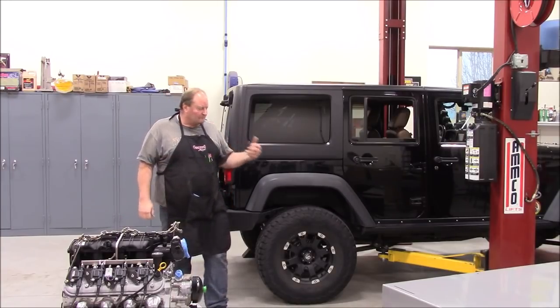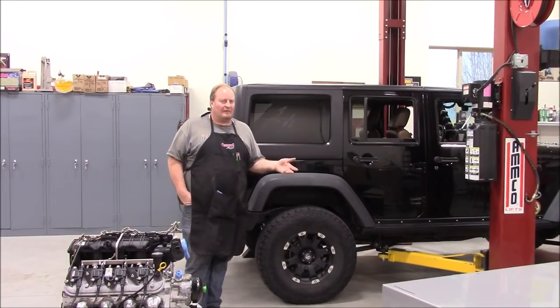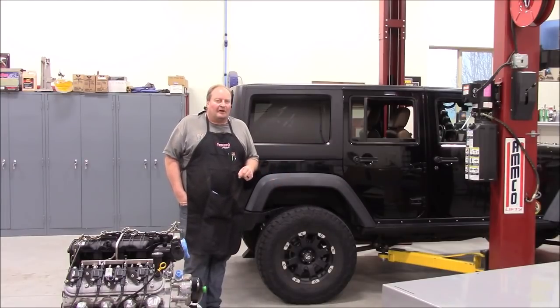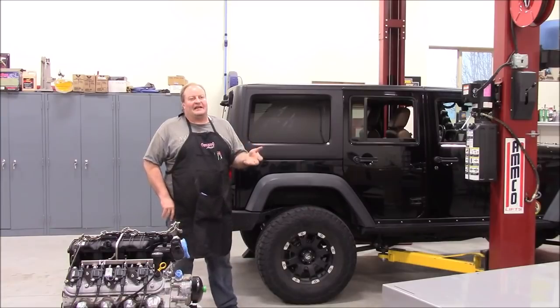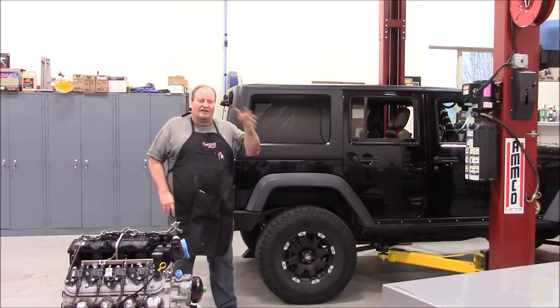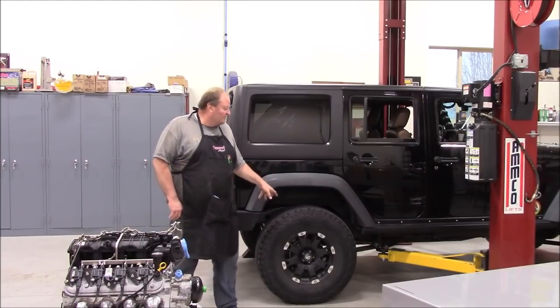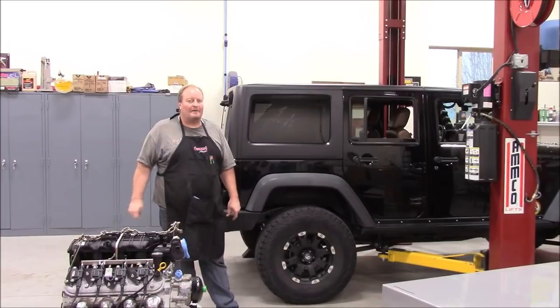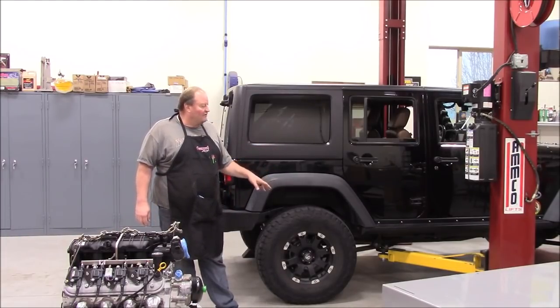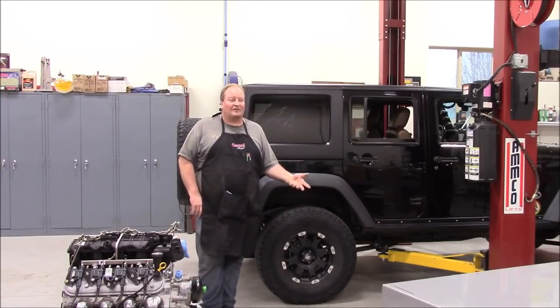The Jeep has about 92,500 miles on it. I've put about 90,000 of those miles on it — we bought it with about 3,000 miles in late 2011. I immediately put a four and a half inch lift under it. It started as a BDS lift, but after a couple years I didn't like having to keep replacing the bushings, so I built my own links. I was running 5.38 gears with 35 inch tires on that four and a half inch lift for about seven years and 90,000 miles.